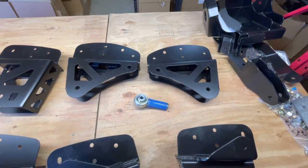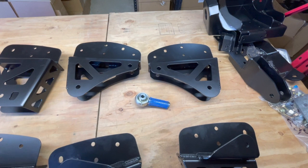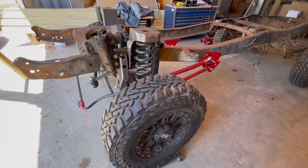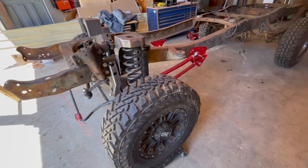Not shown here is the super-high-lift four-link setup, which is meant to be used with an eight-and-a-half-inch sky-jack or lift spring and maybe 40-inch tires. That's not normally stocked but is available as a special order. Here's a look at a 1978 F-150 four-wheel drive with this conversion kit installed without drilling a single hole.